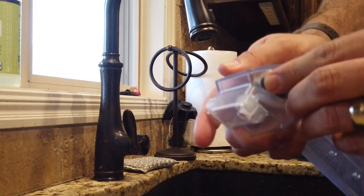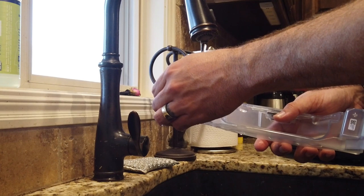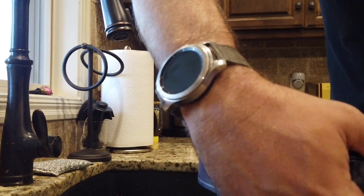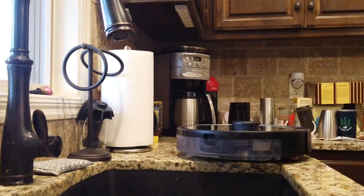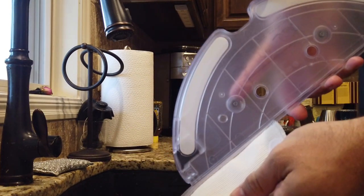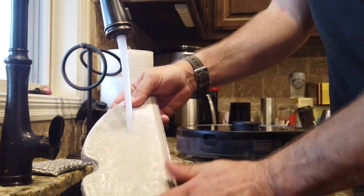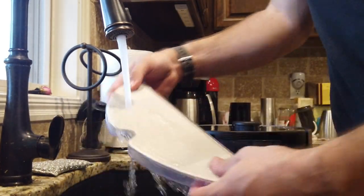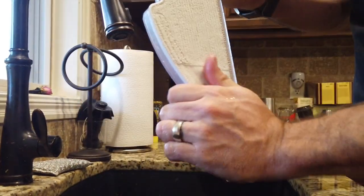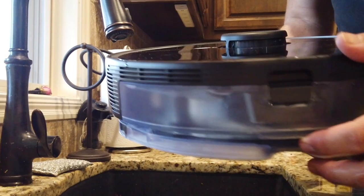After cleaning up the dustbin, I got the vacuum ready to do its first mopping. This involved filling up the tank located on the back of the vacuum — I usually just fill it until the water starts coming out of the valve, then close it up and reinsert it on the back. Before you're ready to start mopping, you need to get the mop bracket ready. The mop slides in on a little plastic rail and you can Velcro it back down to the plate itself. I usually like to pre-wet it so you don't have to wait for the vacuum to wet the cloth before it starts cleaning the floor, and then wipe off the excess to avoid a large puddle.